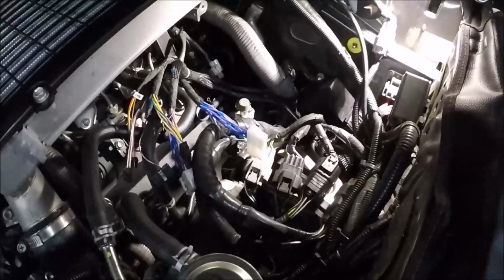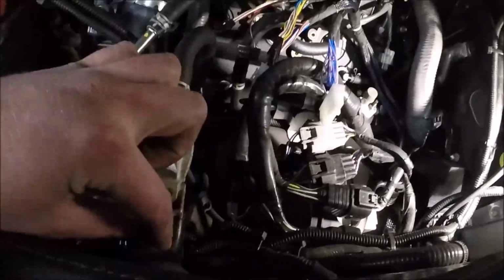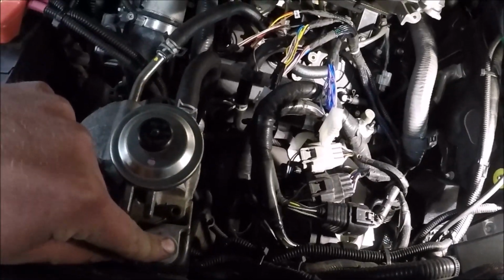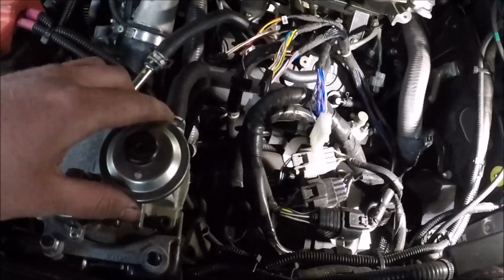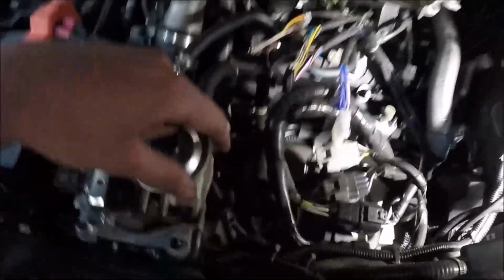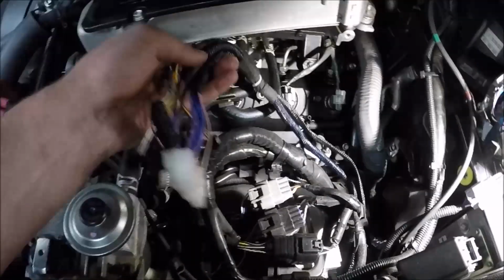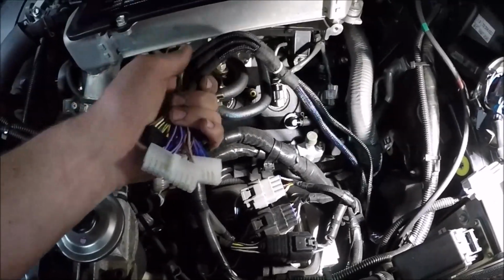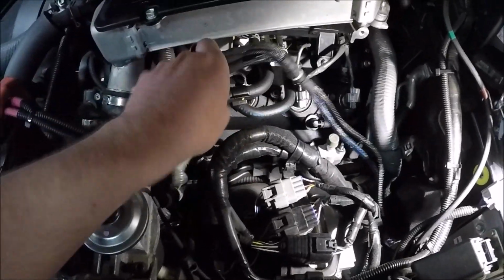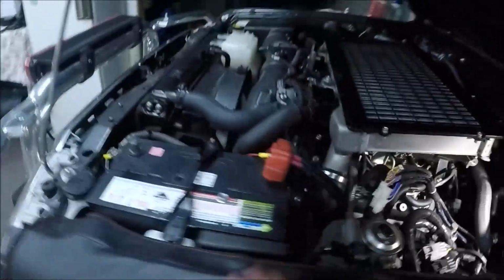Over here is where all the ECU plugs are. The UniChip's basically just going to bolt onto this bolt hole here that's locating the fuel filter currently. There's a bracket that comes for the 3 modules you need to install in this. So we'll just bracket it onto there. There's a little wiring harness here, so we'll basically just wrap that up all nice and neat once it's actually plugged onto the chips themselves, and then yeah, we'll just try and tidy up a couple of bits and pieces in here and run it up.